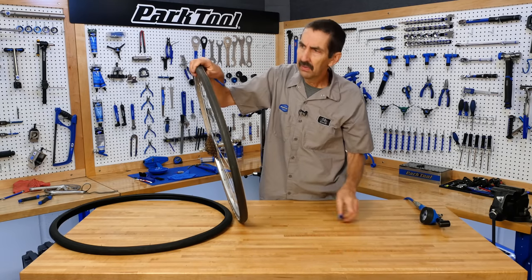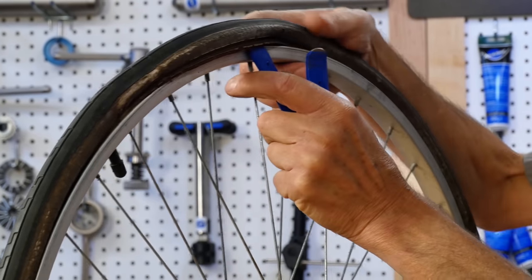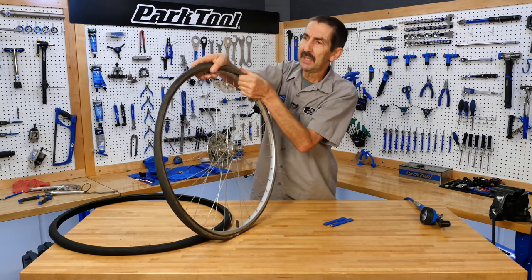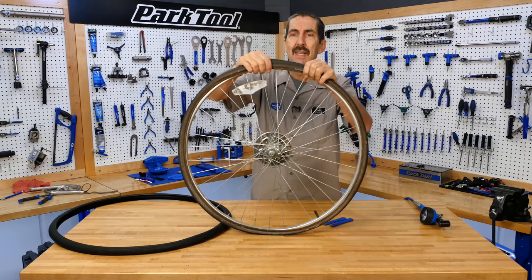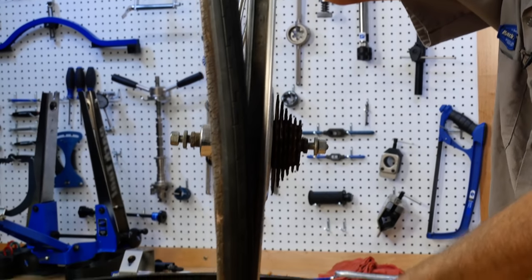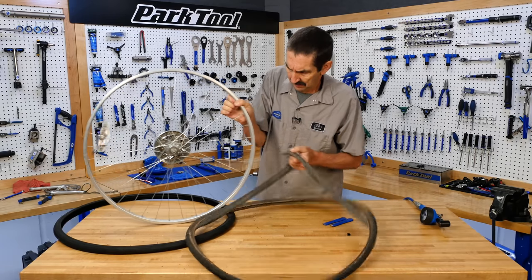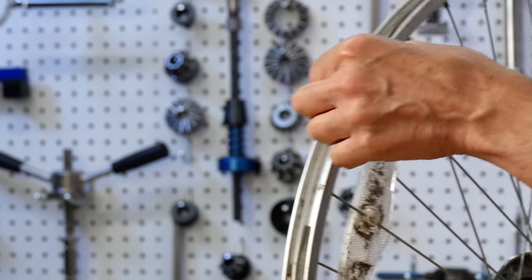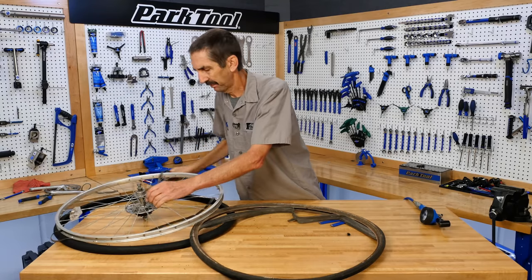We're gonna take the tire lever, and that's interesting to see if we can, some cracking and crunching, and some powder flying as we take this off. It simply could be with the age of this machine that the air has just simply escaped over the years, and it's just not holding. Whew. Man, is that nice. Clean up on aisle one here for sure. Out. Quick inspection inside. Oh, looks like we need a new strip here, exposed and cut. That definitely is a problem.